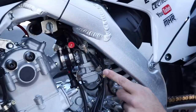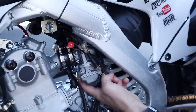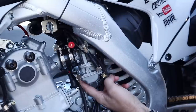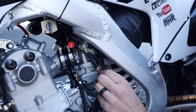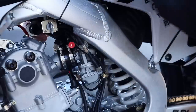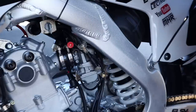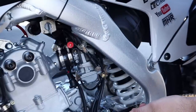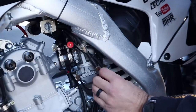The fuel screw is all the way closed right now. If you have this carburetor out of your bike, get one of these Flex Jets or at least an extended fuel screw that sticks out below the carburetor, because you simply cannot get a screwdriver in there and this is an adjustment you might need to make at any time. I'm going to open the screw to about one turn and try again.